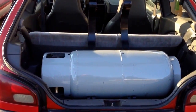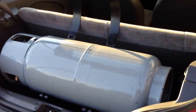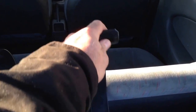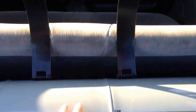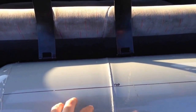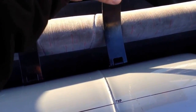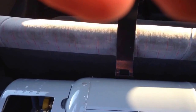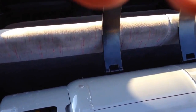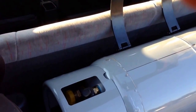In fact, if there was any more, it wouldn't fit and we would have been stuck with eight-gallon tanks, which is this whole tank. These tanks are universal. If you're running a liquid or horizontal propane, it has to be liquid — it can't be gas. Must be a liquid propane tank. It'll run a five, eight, or ten — and I actually haven't seen a five yet, but somebody told me they exist. The eights and tens fit in here, and I mean gallons, so I'm talking a 20, a 33, and a 40.